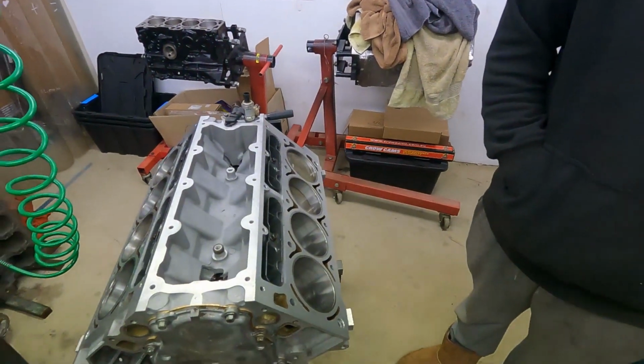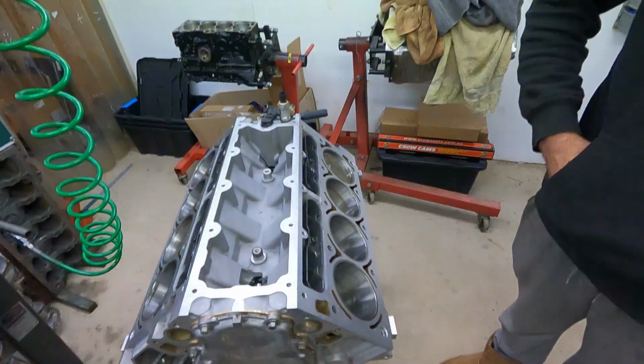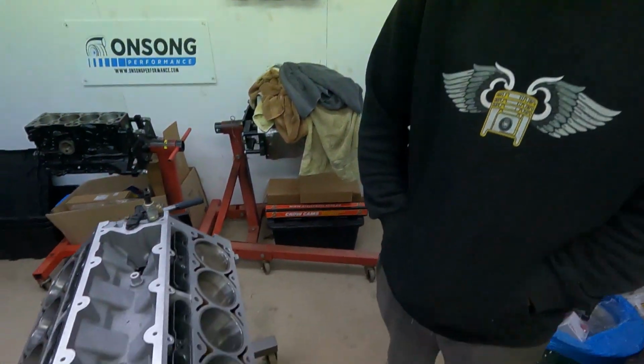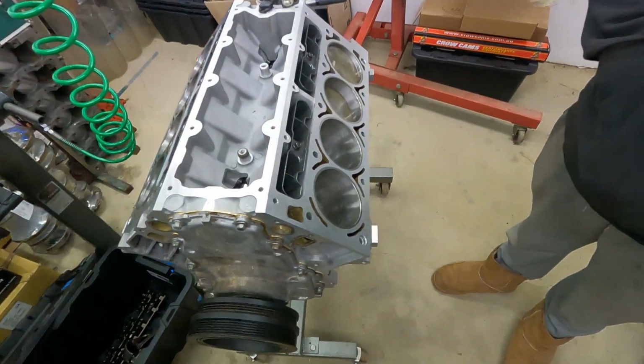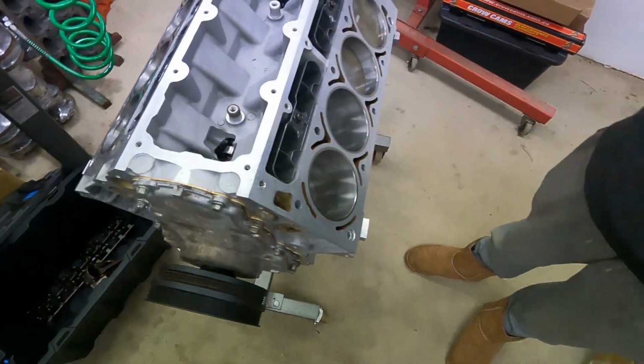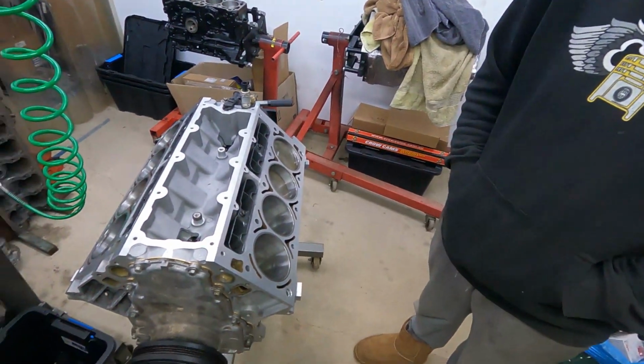That would definitely induce knock. And then number one, obviously, combined with the fact that the rod was bent and the compression height, our quench height was no longer ideal. Number one was the first to fail, but number 5 was obviously upset as well. But the others all seemed fine.